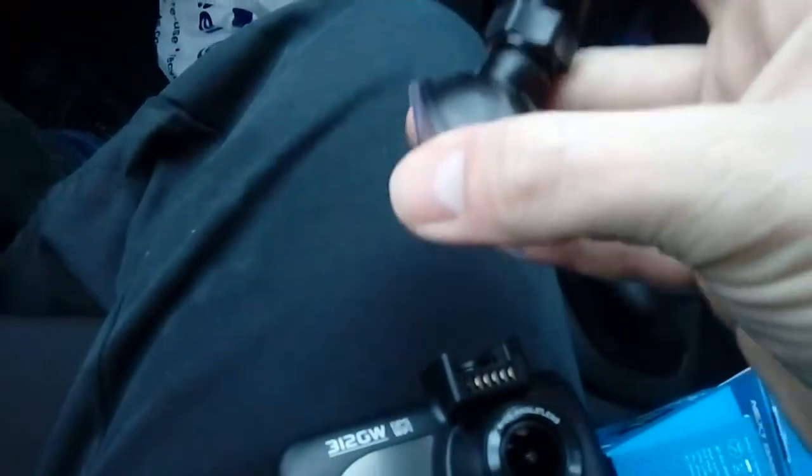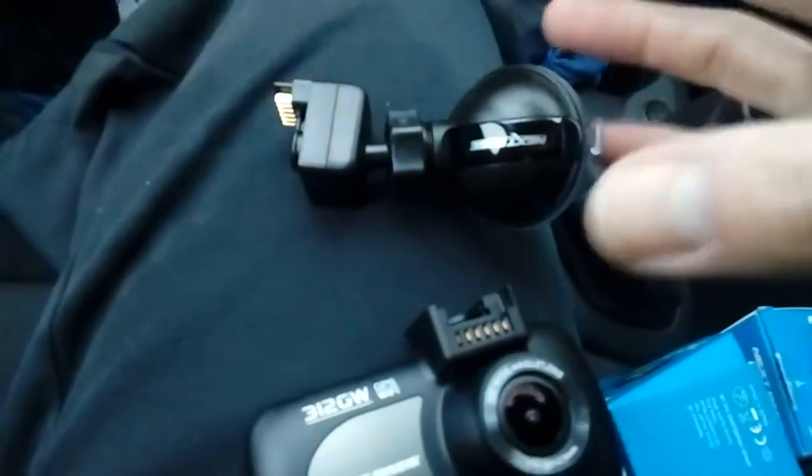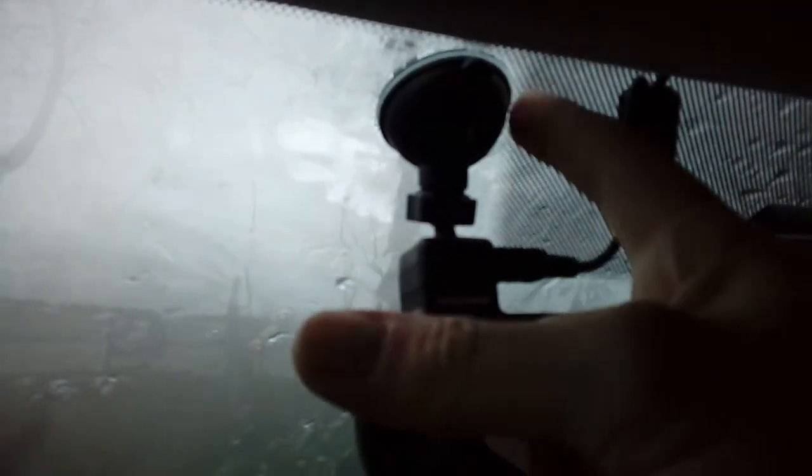Back inside the car. Depending on the windscreen texture here — smooth glass is fine, but if you've got a black area that's textured, you may need to either avoid that area or use a 3M sticky mount instead of a suction mount. This car is textured so we'll be putting the camera on its suction mount on the smooth glass. This camera comes with your standard suction mount — it will only stick to smooth glass. A lot of higher-end cameras come with a separate 3M sticky mount that will stick to the black area near the mirror. Position the camera so it can look down in a triangle and see each corner of the bonnet, in case someone comes across and hits you at the front end.